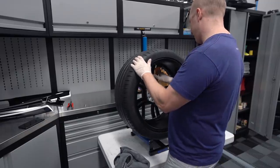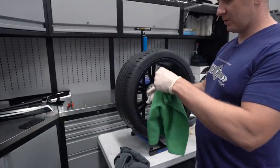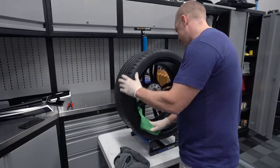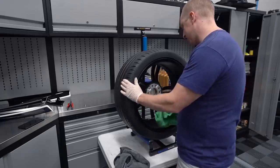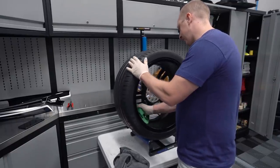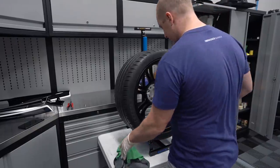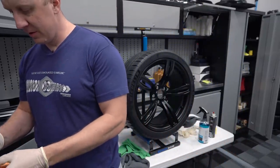It'll make water behavior work better and all that good stuff. This is pretty much wipe on wipe off - by the time I get done with this I'm ready to level it and wipe it using one of my green towels. These work fantastically well for coating leveling or removal of excess. I'm not using a lot of pressure, just kind of moving the towel, getting it to flatten out and make sure there aren't any high spots - a high spot in this case would just be a shiny spot which would be extra product left over.